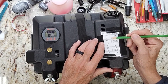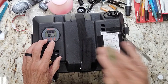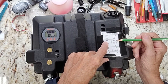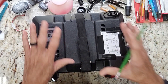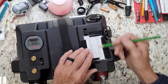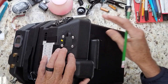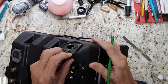This is the capacity chart I was talking about with the LiFePO4 battery. This meter will read voltage, the percentage of charge remaining — which is critical for a LiFePO4 or lithium-style battery — and also the amps you're drawing. When I'm reading 90 percent I've still got 13.3 volts in the battery. I can theoretically go down to 20 percent and still have 12.9 volts. That's the beauty of the LiFePO4 — lithium-style batteries maintain their voltage across a wide span of capacity. On this end is the SAE connector where the connecting cable plugs in, and on this side I can hook a trolling motor straight in if I choose to.